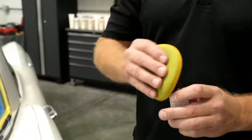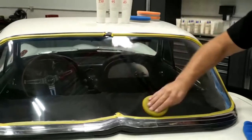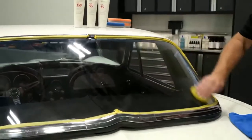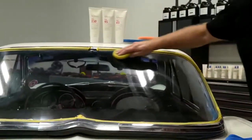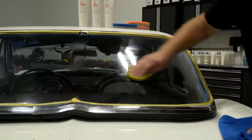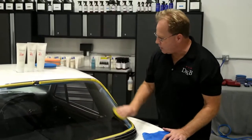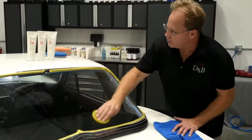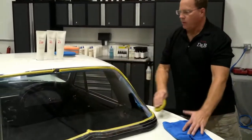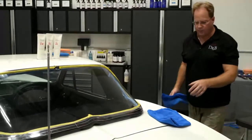Okay. Just a little bit. Just a little bit. Get some reflection going on. And then for the MX, nano resin MX ceramic coating, you only wait about 30 seconds to a minute. You'll see it start to flash, then go ahead and wipe it off. And then I would call this side done. Let me get a fresh clean towel for the final wipe there.